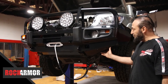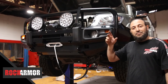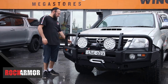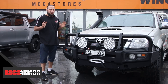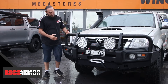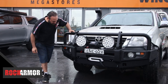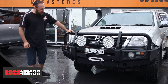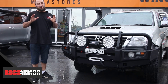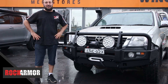All right guys, the bash plates are all tightened up, the bar's all on, all the wiring's done — this car's finished. Now let's get upstairs and see how it looks. So I've got the Hilux out of the workshop — really nice finish. It's a complete bumper replacement, which makes fitment so much easier. The Rock Armour Bull Bar comes with your 63mm tubing, three-piece bash plates right across, built-in LED fog lights, indicators, and park lights. Overall it's a really, really good finish — a really good looking bar. You guys are going to be really happy with it on your vehicles. Thanks for watching another Big T video, and I'll see you guys on the tracks.